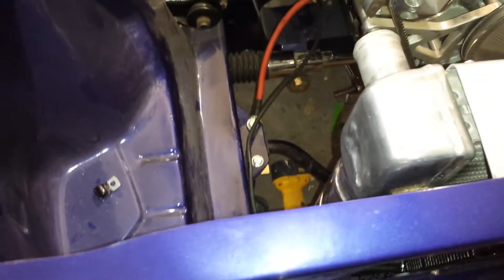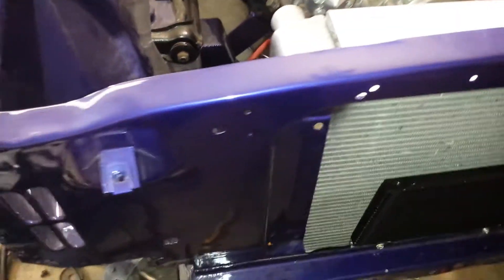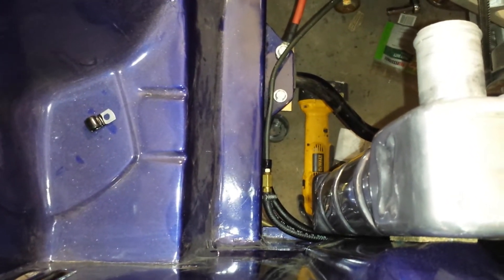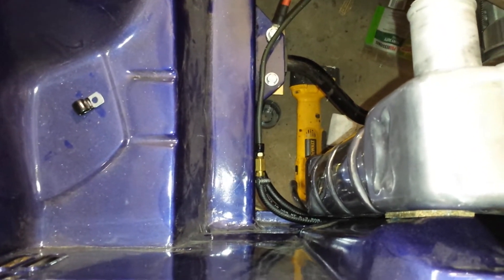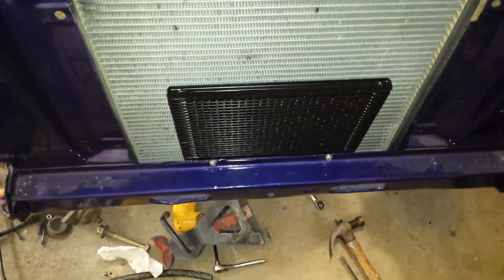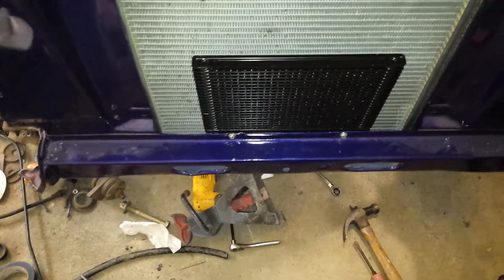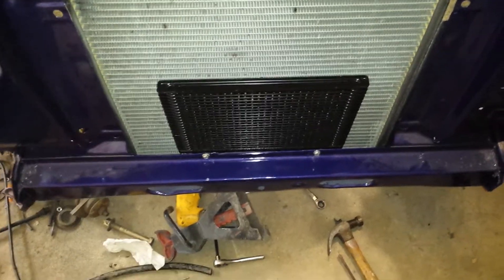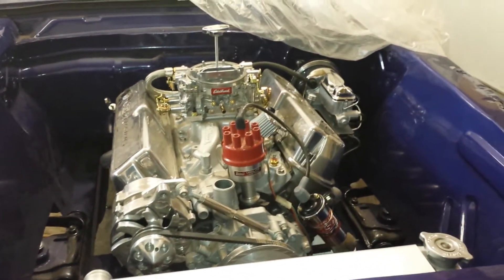That's the way the car sits. Progress is progress, didn't get too much done. I was chasing around trying to find those little brass fittings for a couple days. The line coming out of the transmission is 5/16ths and the nipples on the bottom of this cooler are 3/8ths. I was trying to find a fitting to go down from 5/16ths to 3/8ths and looked everywhere for two days — nobody had anything like that. So what I ended up doing is getting some fittings for 5/16ths, getting a 5/16ths rubber hose, lubing it up a little bit, putting a hose clamp on it, and sliding it over the 3/8ths nipples. It was pretty tight but they went on. My only worry is the hose deteriorating and cracking quickly where it's stretched tight and snug. Fingers crossed it works for a while, and if I have to replace it I'll figure something out later.